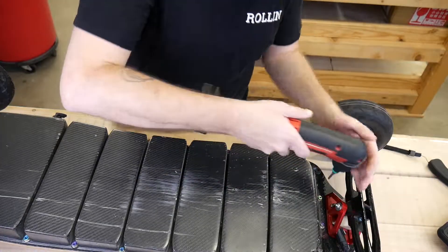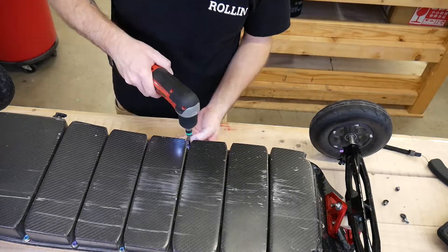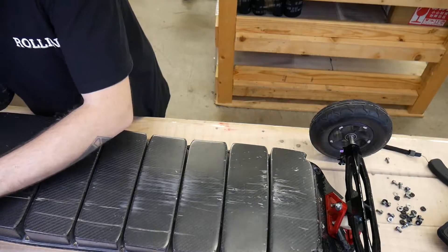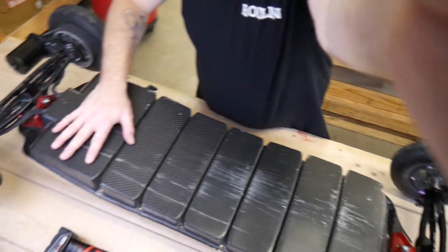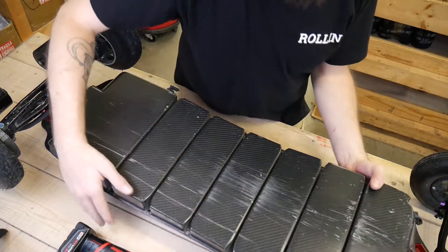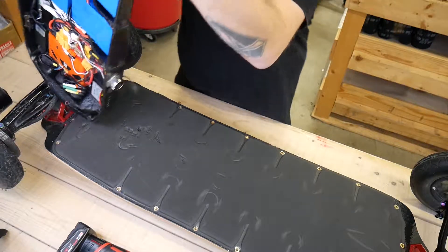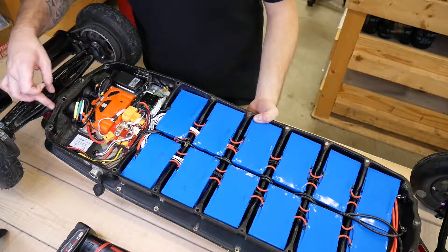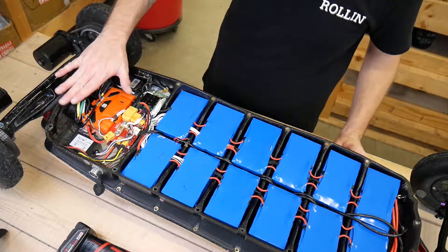As you can see I also have to disconnect all the lights. Once the screws are all removed, we need to flip the enclosure. I don't suggest just taking one side — you have to take it placing your hand on this side, make sure you can handle it well, and just lift up to 90 degrees and flip it on its back. The cable here is probably going to be a bit tight, and one of these grommets might come out, so just be careful. If a grommet gets out, you can just push it back at the end.